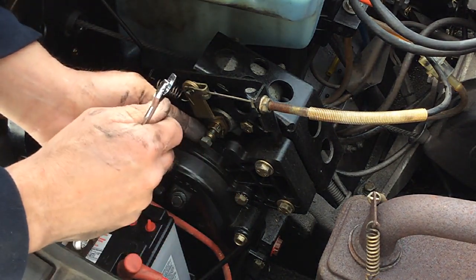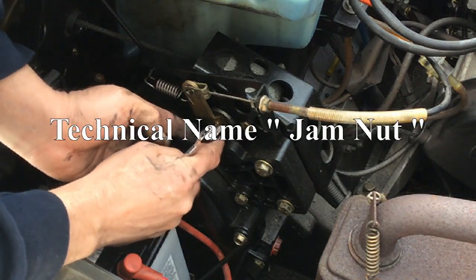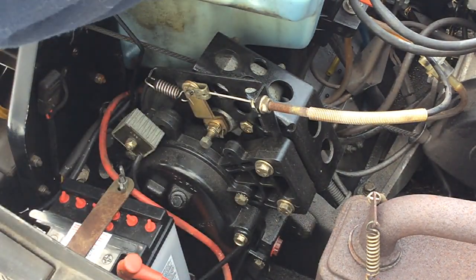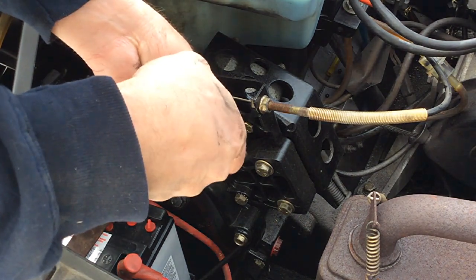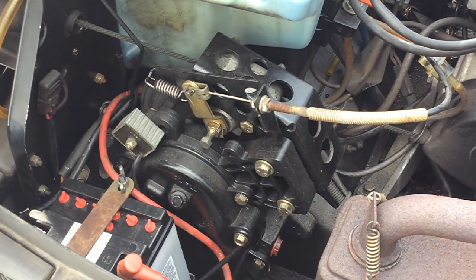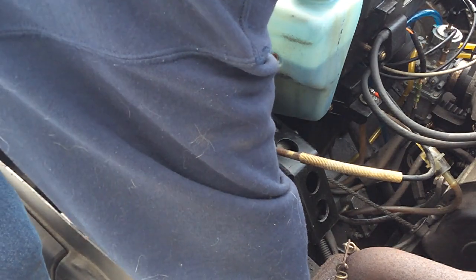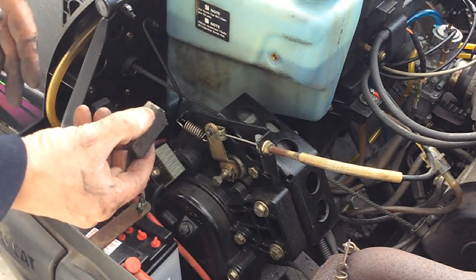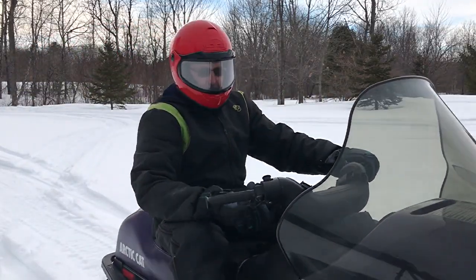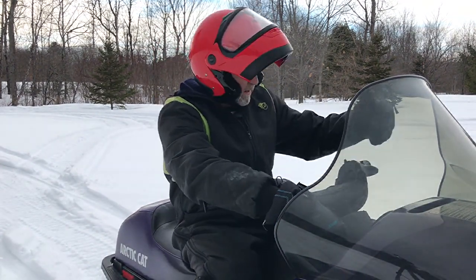You may find once you get going and get a few miles on this, you may have to come back and adjust it. Down below here there's a little lock nut that you have to spin in. I know there's probably an Arctic Cat person out there saying I'm crazy, but I just kind of spin that a little bit and give it a little chunk and it keeps it right there. Just check the brakes right there. Double-checked everything, now close it all up, get rid of the old pads, and let's take it for a quick test ride.